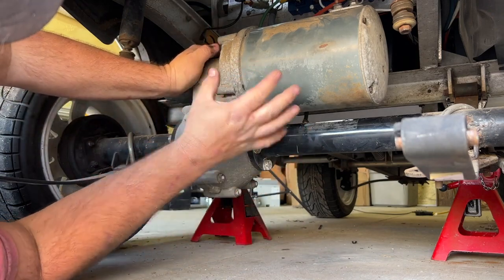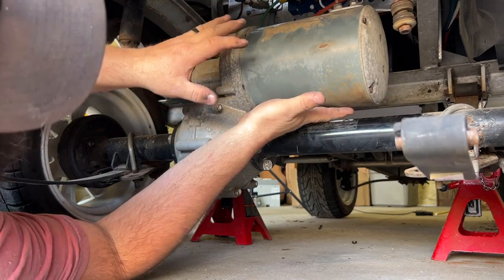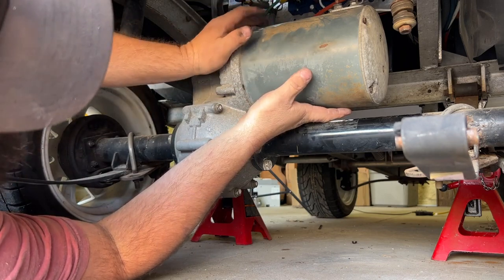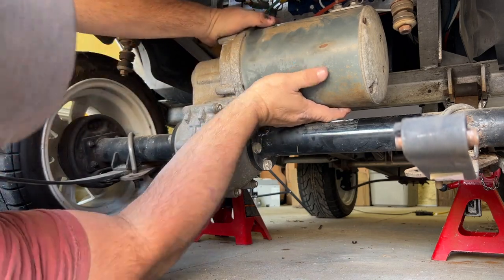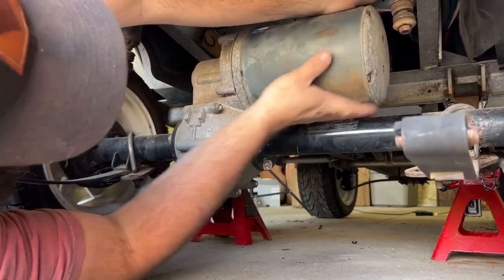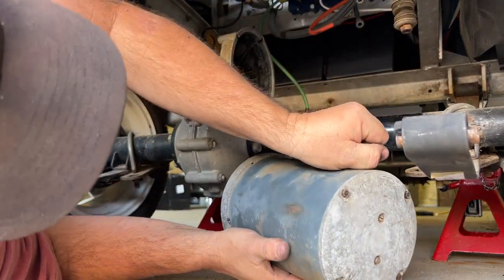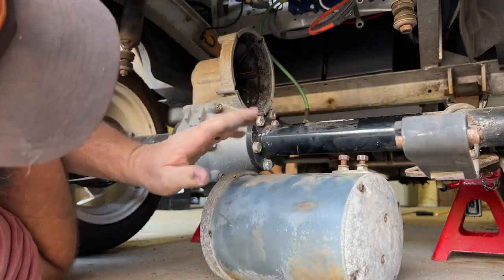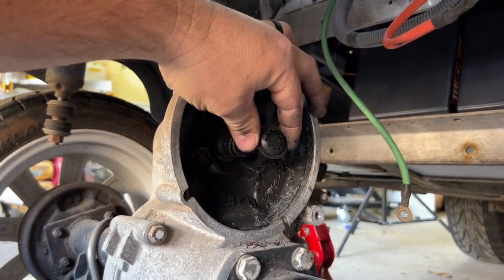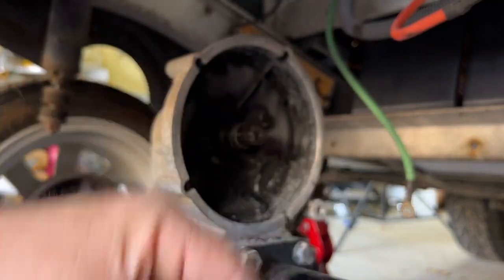All the bolts have been removed from mounting the motor to the transaxle. I'm going to take my hand and lift up and down, rocking it in a back-and-forth motion. This motor probably weighs about 25 pounds. It came off pretty easy — the motor is now off. If yours has a bushing that slides onto the shaft, you can remove that and the spring behind it as well. We don't need that for the Plum Quick motor install.